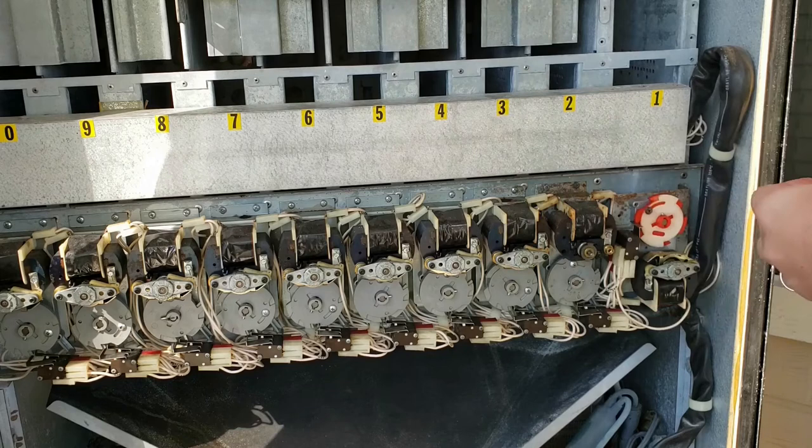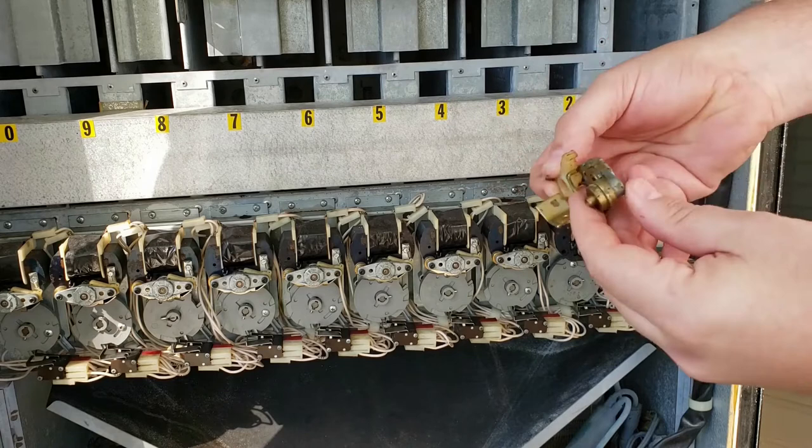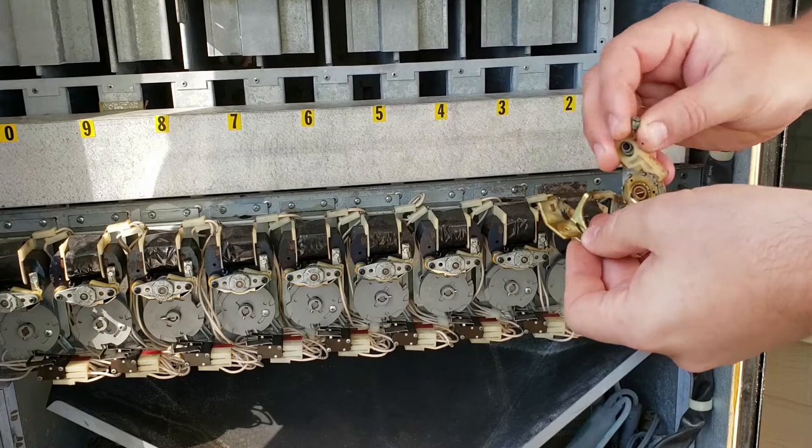This whole assembly seems to come out at once — just a little spring to remove on that part of the haul gear. You can see how the whole mechanism works. There's a small washer here, make sure not to lose that. Set that aside, and I'm going to lubricate every one of these points — first clean the whole thing off with brake parts cleaner, and then lubricate it all.